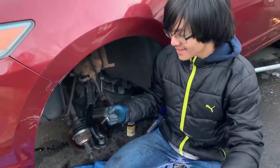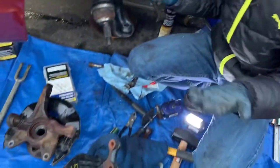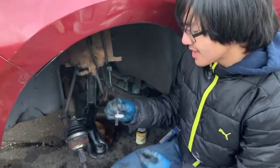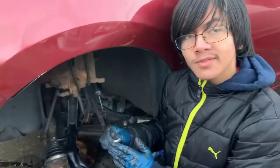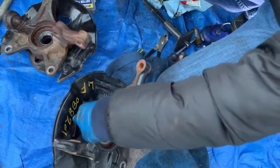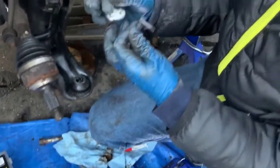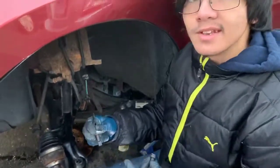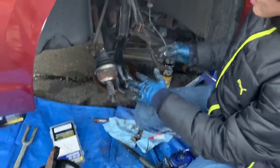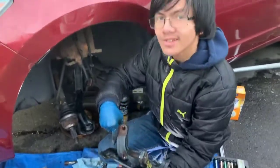We're back. It's been around 15 minutes and we've had a lot of trouble with taking out the ABS speed sensor. First off, it was hard to get out, and while we were getting it out, we actually broke it. So you can see that we put some super glue and baking soda on it, so it should hold up. The reason we can't use the replacement part is because there's really no way to attach this old wire without cutting it, and we don't want to do that. If you didn't see already, we already took out the knuckle.